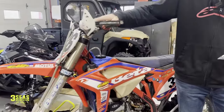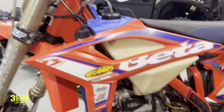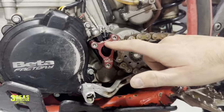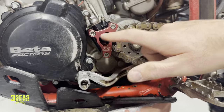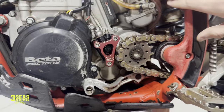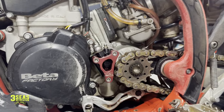This is obviously our clutch side and our fill is going to go in here, so in a minute we're going to pop this cap off. But this line comes all the way down and this is our Slave Cylinder here. On Jared Fortner's bike in particular we already have the guard on here, so you folks might not have this. When we do our job to remove this we have a hex head — you might just have 8mm bolts with a guard that comes all the way up and over, so you might have to pull that stock plastic guard off. Ours is a billet aluminum one. Let's go over to the counter and I'll show you the tools.